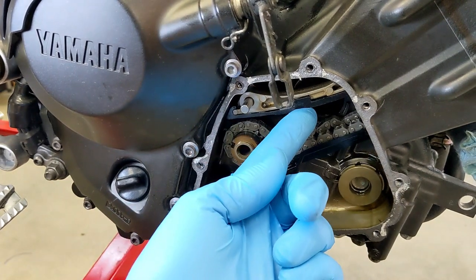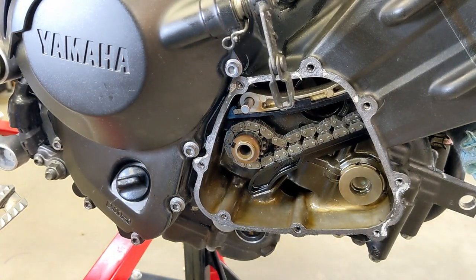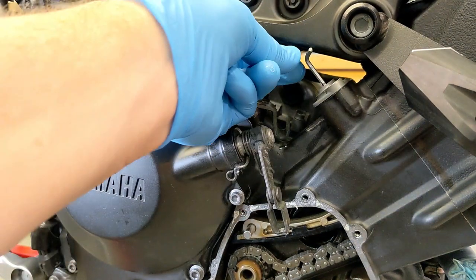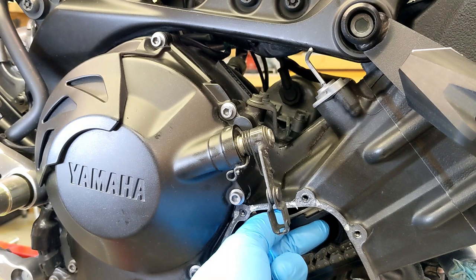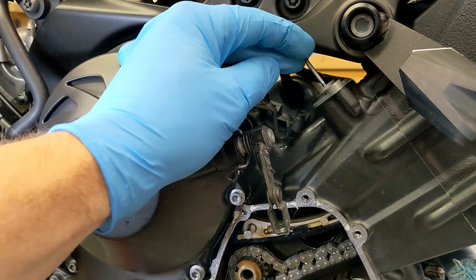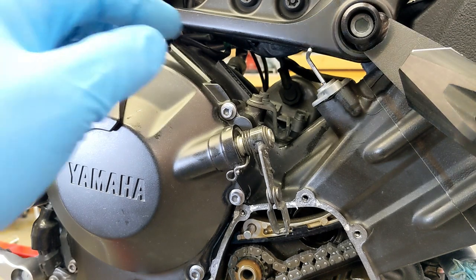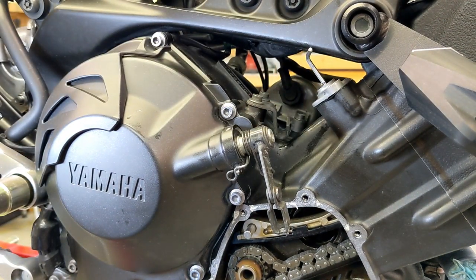So I'll be able to watch what's happening. When I put the cam chain tensioner back in with my cut-off key there and it's bolted down, I'll be able to spin this out slowly. As it comes out slowly it'll move down like this, versus if you just pull the key out it would slam. Right now I can tell the little allen key I made is too long — it's hitting the frame. So I'm going to cut that down, or it might not be a bad idea to just buy the tool, since it had a little knob you could just turn. I've got to decide if I'm going to buy the tool or just modify this.